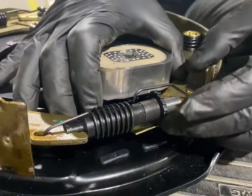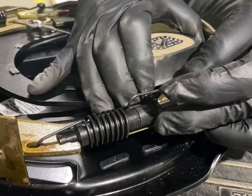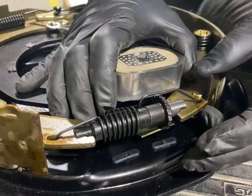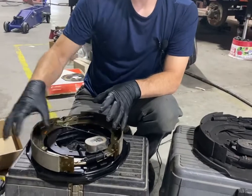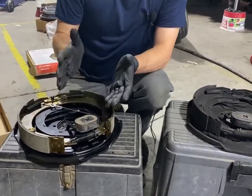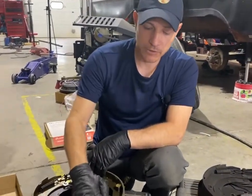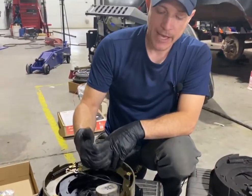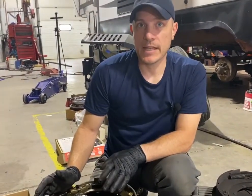So as you make a brake application, it'll go up and down, up and down. You just heard that click, and now it just is self-adjusted. So every time it does that, it's going to give you the perfect adjustment, so they say. Now, here's the disclaimer behind this, okay? The self-adjusted one, there are little notches here, and what happens is they have to get to a certain point where that finger can grab. Can you adjust these? Yes, you can.